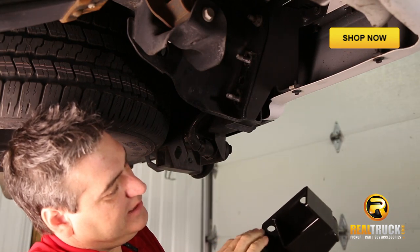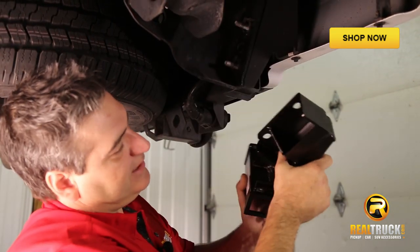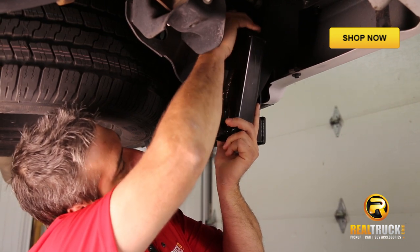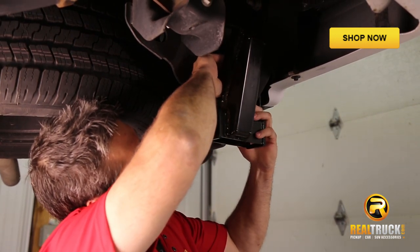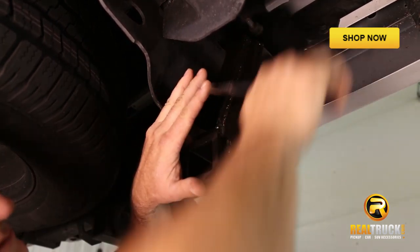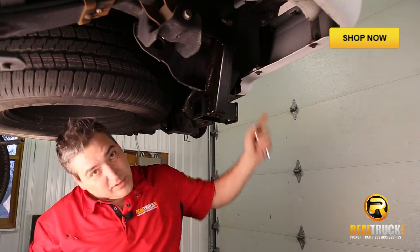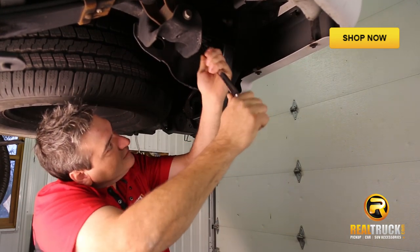Something I want to point out is that this plate here is what we're going to put flush up against here. If you try to put it the other way, it's not going to work and it's going to create a lot of headaches. So go ahead and stick that up there and get your nut started. Grab a ratchet and tighten that down. Once you've got those snugged down, grab the breaker bar and give it a little extra oomph just so we know this isn't going to come loose. Our bracket's installed.